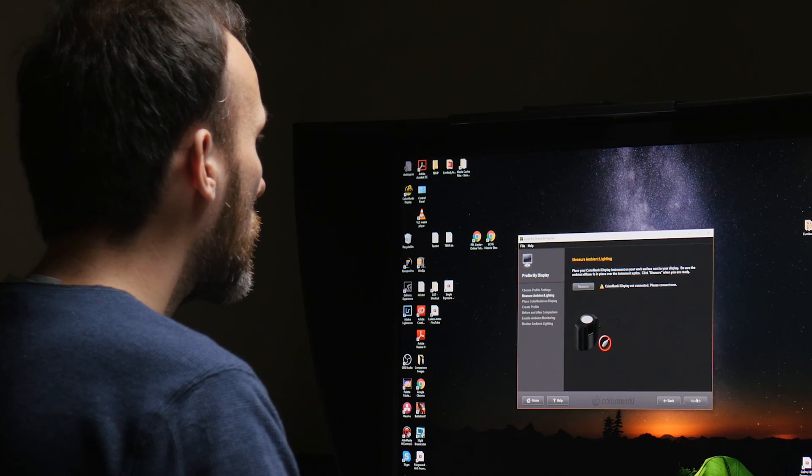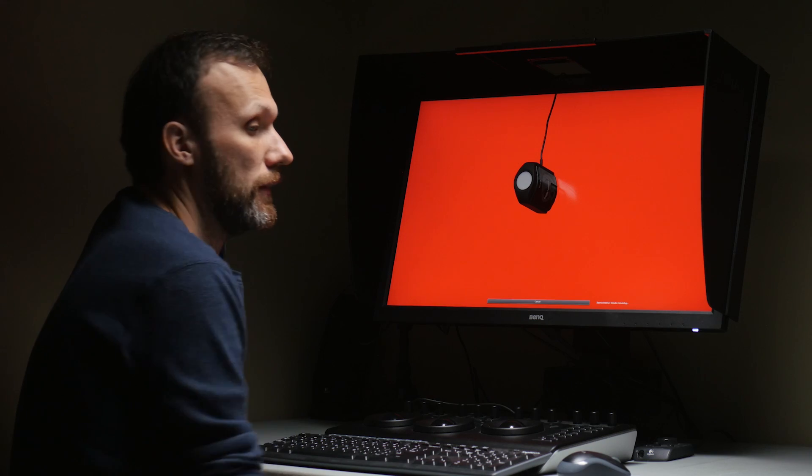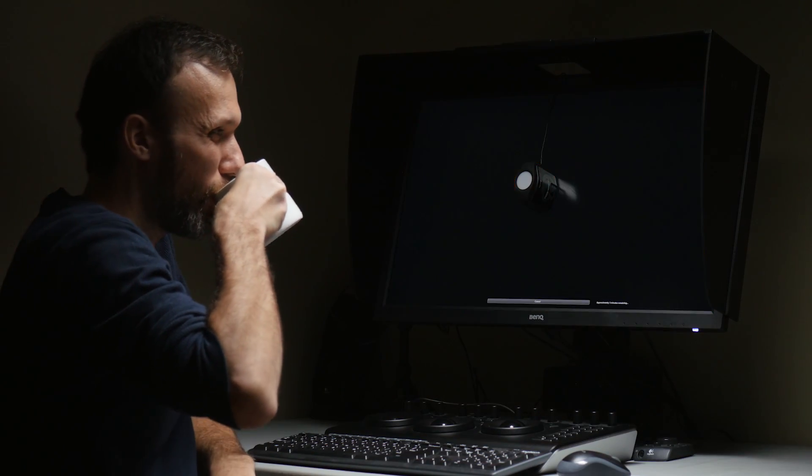When it comes to the software itself, both of them have pretty good and easy-to-navigate software. It's pretty much plug and play — plug this into your computer, follow the instructions on screen, and it's going to take about five to ten minutes. You're not going to be using these just once; you do your initial calibration and then the software will remind you after a certain amount of time to recalibrate, because every monitor has a tendency to drift with colors over time. The software also lets you save custom profiles and do before-and-after comparisons so you can see what the calibration did.